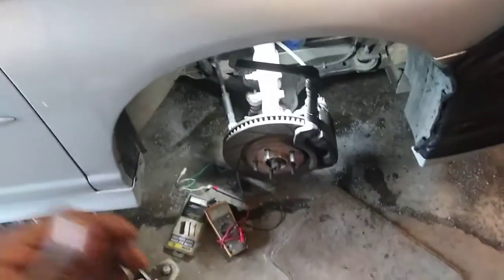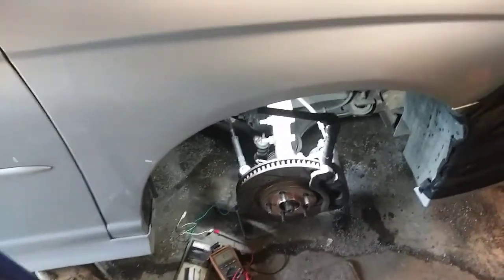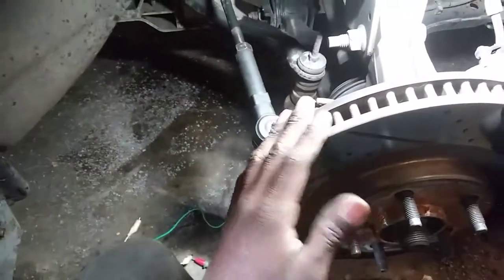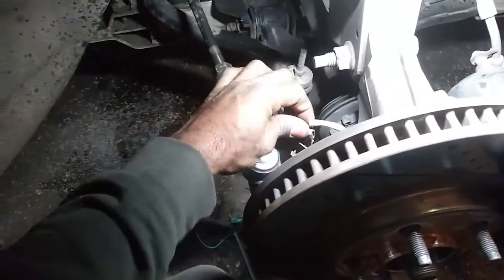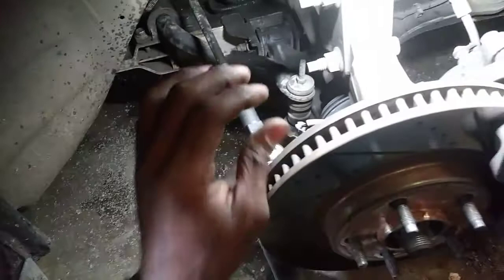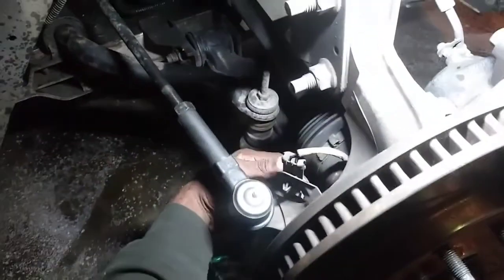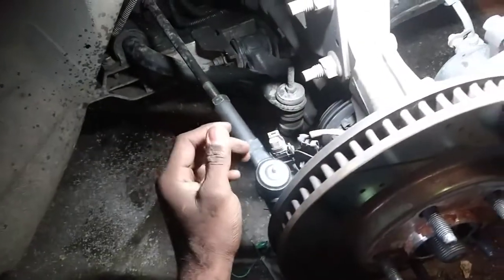Do this at your own risk — that's my disclaimer. I'm going to go through some basic tests. I'm not going to pull the oscilloscope out today; I think this can be managed without it. So I'm turning the wheel all the way to the left so we can get a better look at the connector. This is the ABS wheel speed sensor connector. We're going to do a quick resistance test from this connector going to the ABS module — the male end going to the wheel speed sensor.